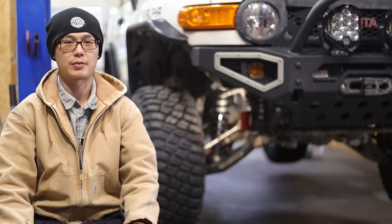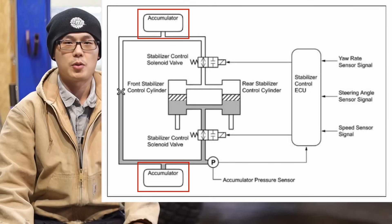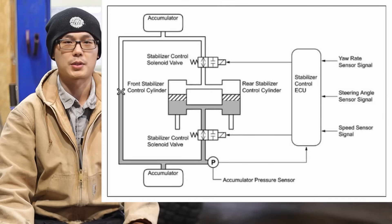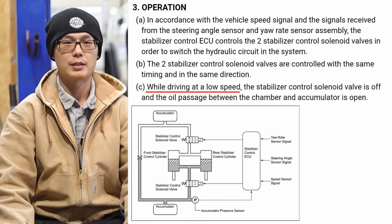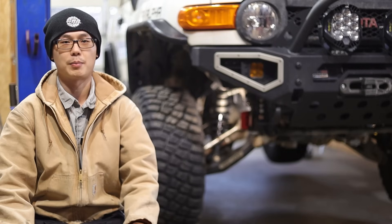The GX will probably get worse after a lift. After some research, I found that in addition to the front and rear hydraulic cylinders, there are two accumulators between them. The hydraulic paths to the accumulators are gated by electronic solenoid valves. KDSS behaves like shown in the marketing video only when the solenoid valves are closed. When the solenoid valves are open, hydraulic fluid can flow in and out of the accumulators and the front and rear cylinders behave independently — which I verified with testing. At below 12 mph, the solenoids are always open, so the front and rear suspension travel are not forced to be equal, nor is there any body roll resistance. Off-camber stability is therefore a serious drawback.